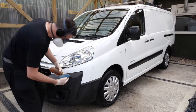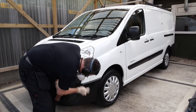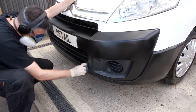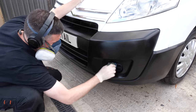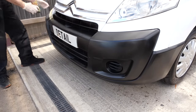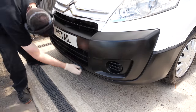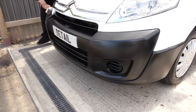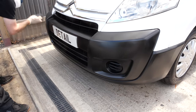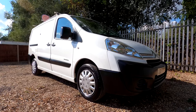One of the biggest things that fade on these old vans is the plastic trims, so we're going to use a product by Concept Chemicals called Vista. We're just going to rub that into this bumper and as you can see it's highly effective - it's going to darken it right back down. Two things to bear in mind: it needs around three to four hours to cure and go off, and you cannot put it outside in the rain or frost until it's fully cured or it starts getting blotchy and white. So keep the vehicle dry for at least four to five hours before putting it outside.